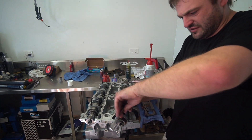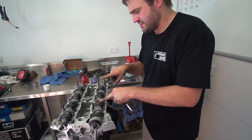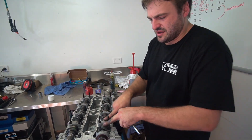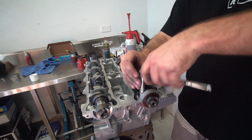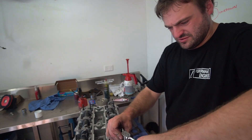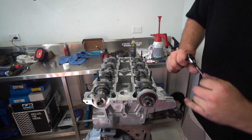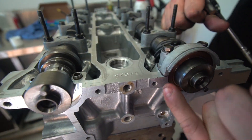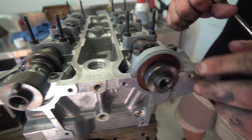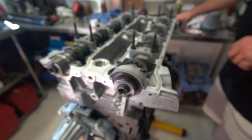Some people say you can't take the caps off when the cam is tensioned down — yes, you can. This cam and this cam are on lift, but the cam in front has no lift, so there's no tension on it. Taking that cap off won't snap the cam. Now see the oil seepage there? That's what we want to see — come out the front like that. That's where it's going to leak.